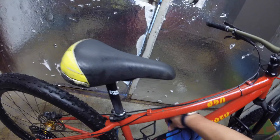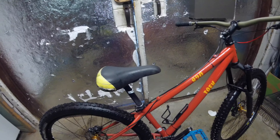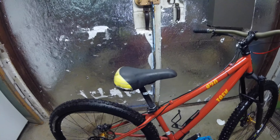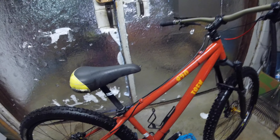Now we have a pretty clean bike and it is ready to ride. When the tires dry up I'm going to put some photos in there, along with clips from yesterday's ride that got this bike really dirty. Hope you guys enjoyed this video. I'm going to put some chain lube on the chain — that's going to make sure it doesn't wear out prematurely. Run it through all your gears and it's going to be perfect. That is the most important part: you never want to run a dry drivetrain because that's going to ruin the longevity of your drivetrain components and they can be very expensive. Thank you guys for watching. This is Spencer's Bike Hacks and I'm signing out.